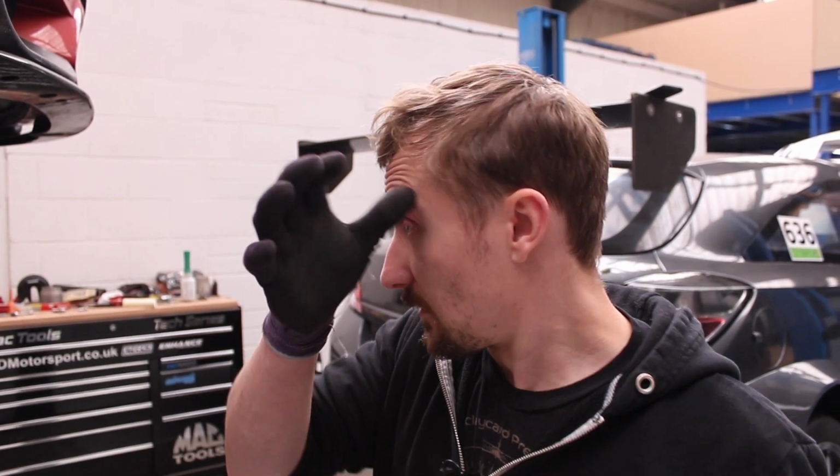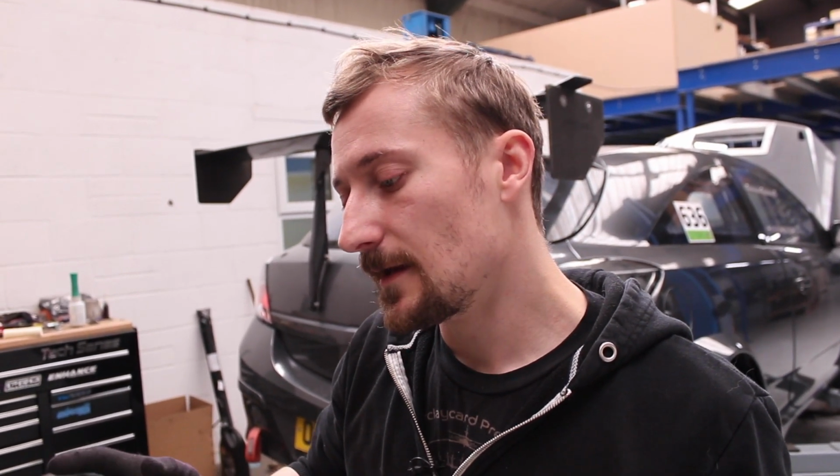The M4 S55 engine has twin turbos as standard, electronically wastegated, and that's what we're going to stick with. There are others I've seen, usually in the States, where they've got single turbos or big external wastegates and things like that, and it can all be done, but the issue becomes actually controlling the turbo, boost control and things like that. You want things to work with as many OEM parts as possible, and that really is important when it comes to the boost control.